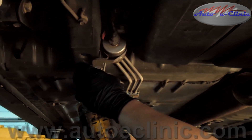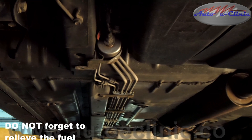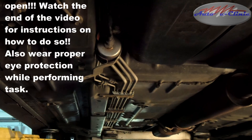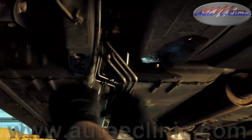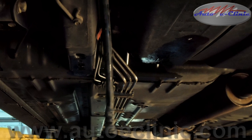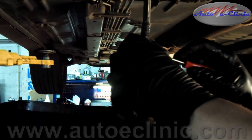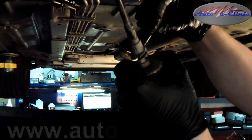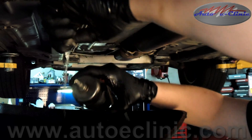It's a very simple process. I've got one bolt holding the bracket. On the GMs I always use a 16 millimeter or a 20 millimeter to remove the bolt on the line. Here's the quick disconnect — you just simply push the top in and then release.